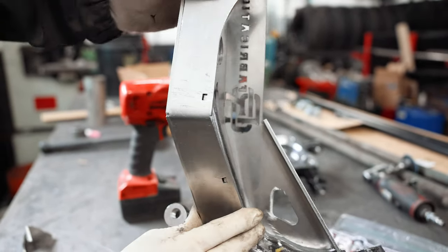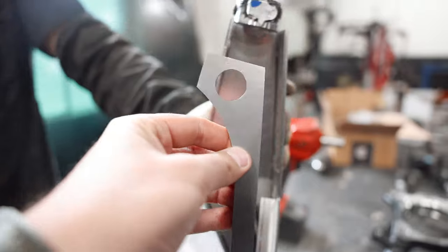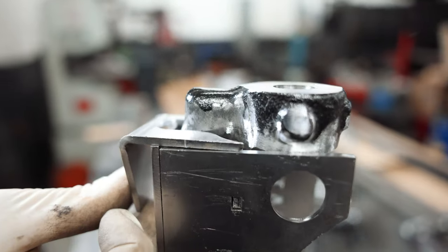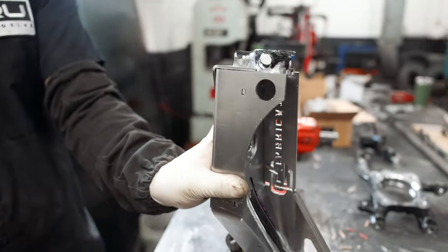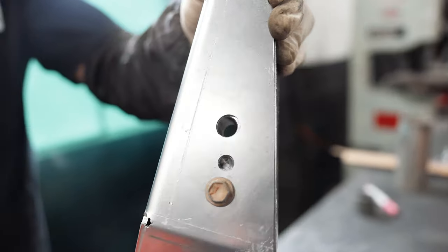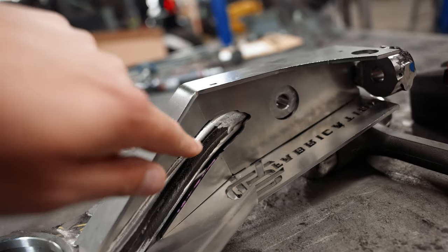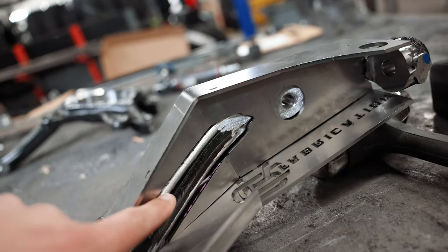Now you've got your outside box, and this little piece here is going to close this off. Then we've got our little top piece that goes on top of the spindle to box up and close off the top. These are side specific. The top hole is for your sway bar, but we don't run sway bars due to down travel so we won't worry about that. Before putting this together around your spindle, get it roughly together first and then grind down what you need to grind — it goes together a lot easier once material is removed.